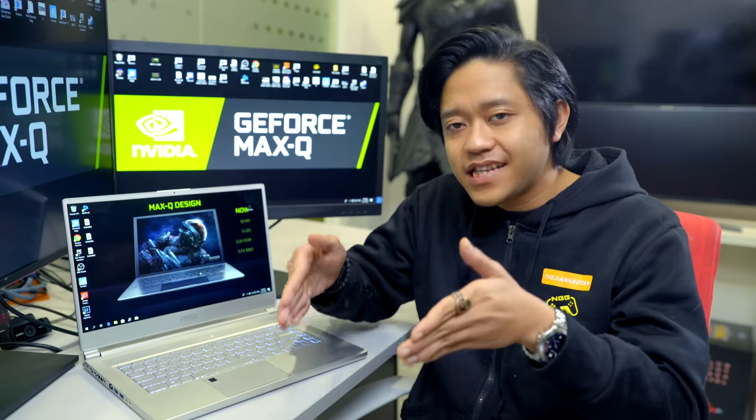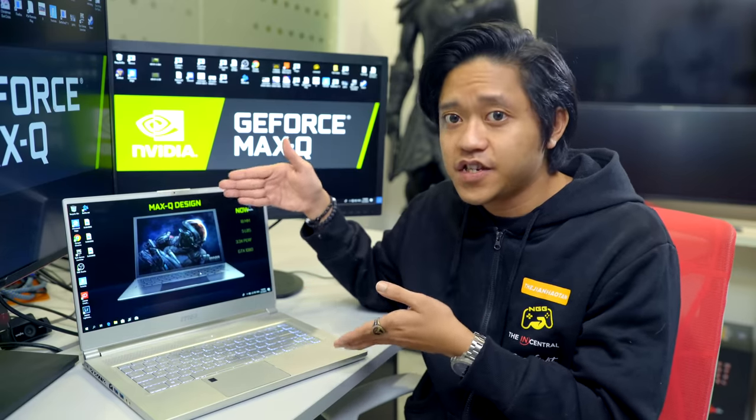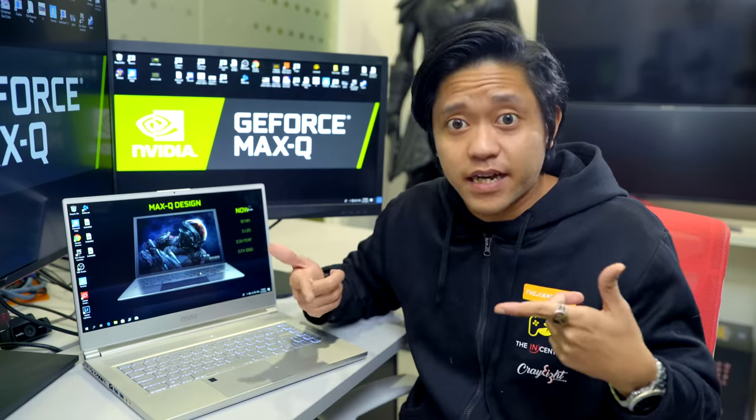For those who don't know what Max-Q is, here's a quick insight. Max-Q comes from aerospace engineering and stands for maximum dynamic pressure. In a laptop context, it's about power and heat efficiency — it keeps your GPU at the sweet spot for maximum performance without overclocking or overheating, and prevents the fan from running overtime. You do miss out on higher frame rates, but it keeps the laptop at an optimal level. Keep in mind, this is still a prestige laptop, not a gaming laptop.